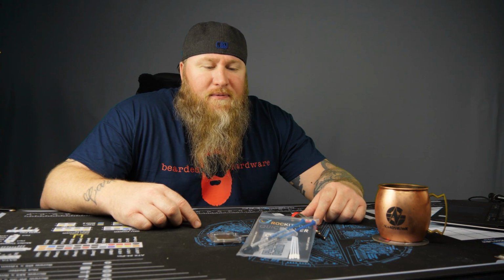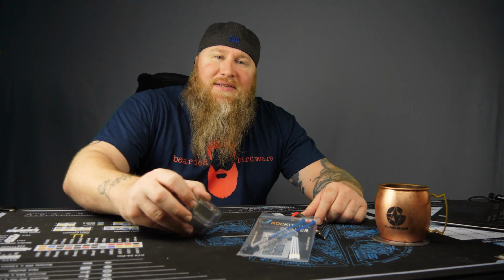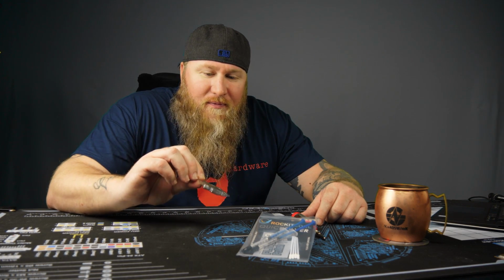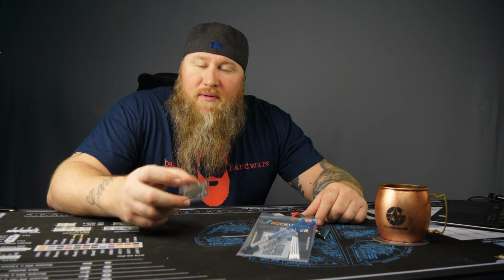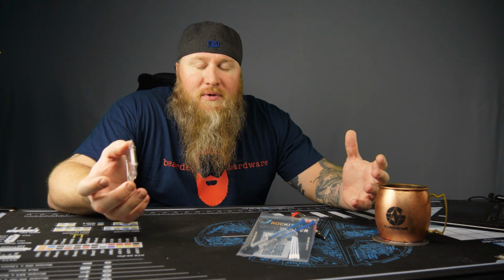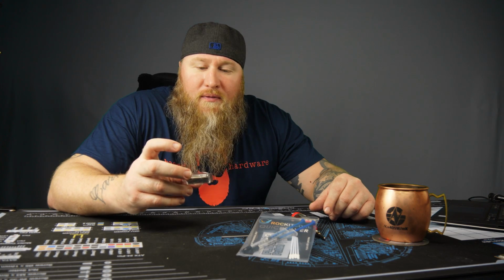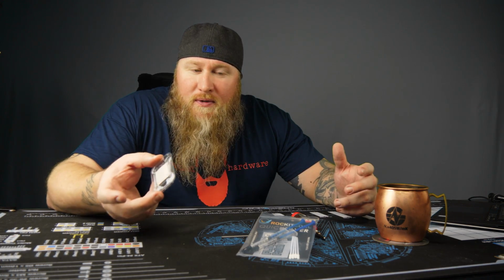We got some cool stuff. Basically, we're gonna take this 9900K and we're gonna pop the top. So we're gonna delid it. You guys don't realize, but this is actually a soldered chip. So what we're gonna have to do is pop the top and then remove the solder.